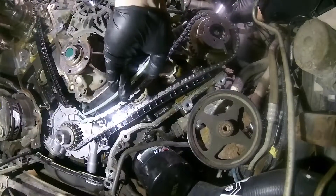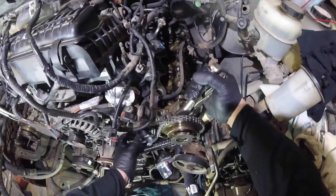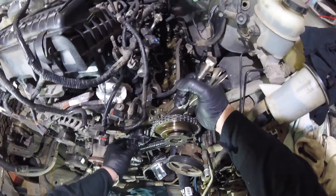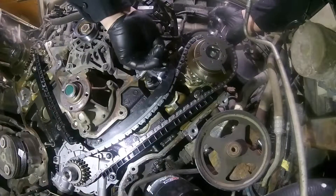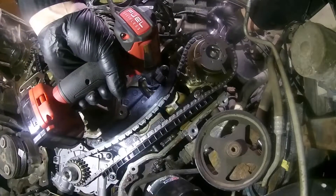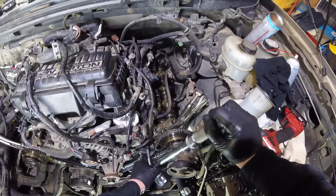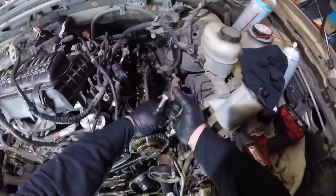Let me just see if I can loosen that chain up a bit. Let the guide in there — I need to hook that tensioner up in there. These bolts are torqued down to 18 foot-pounds, so you want to really double-check those ones. And then I can pull that pin — but she's already tight. I can pull my vice grip off because I don't need it on there anymore.